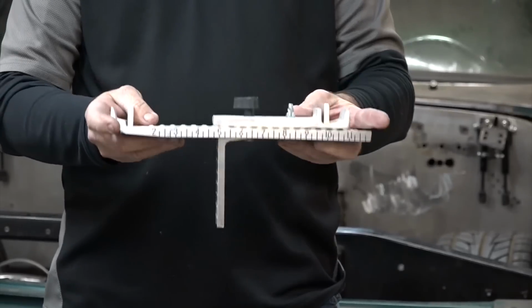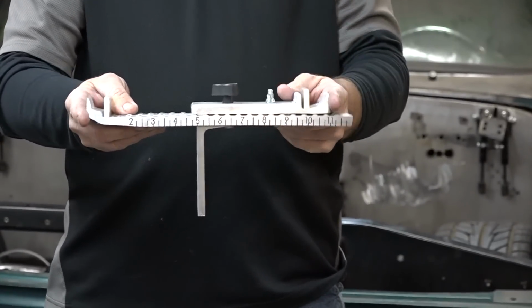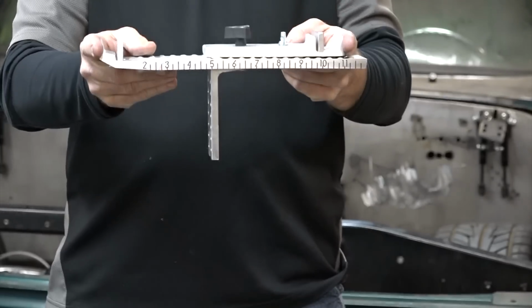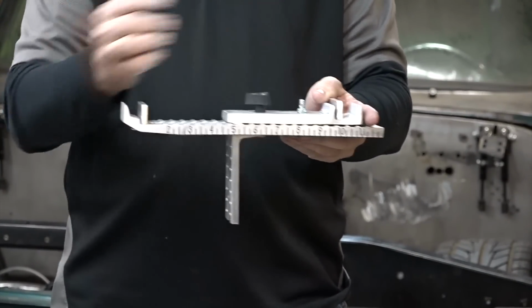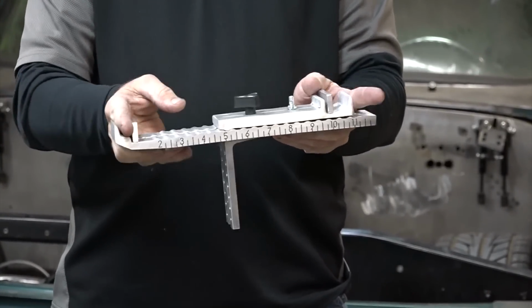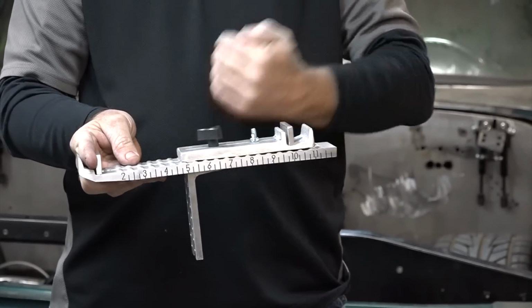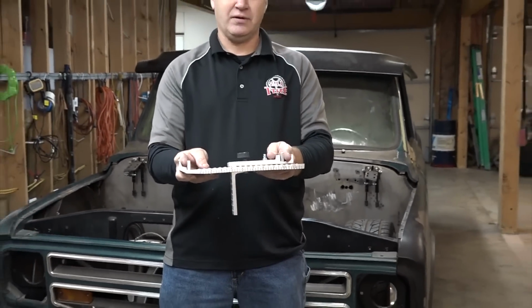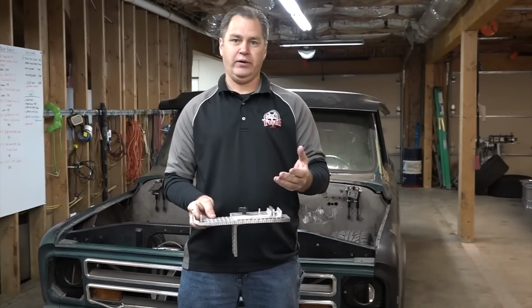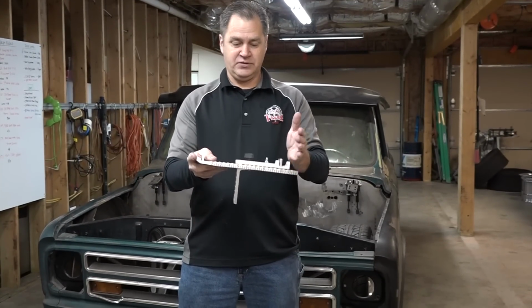So how I do that is you've got a horizontal extension that moves back and forth here. If you'll notice here and here, this represents the overall width of the wheel with the flanges here and here where you would typically hammer weights. The measured width where the tire sits is actually in here, which is 1 inch less than the overall width because that's where we actually measure from. So if you buy a 10 inch wide wheel, physically it's going to be 11 inches overall. So that's how that works.